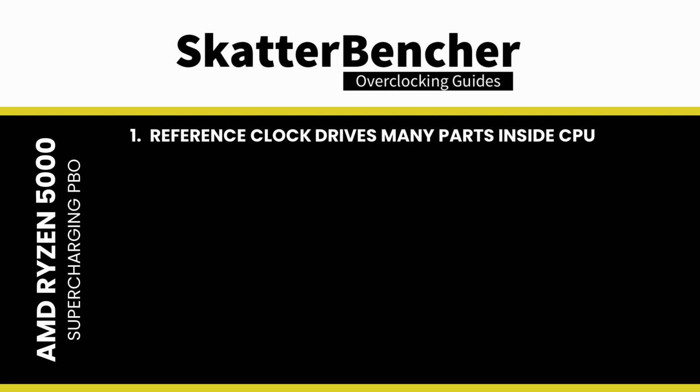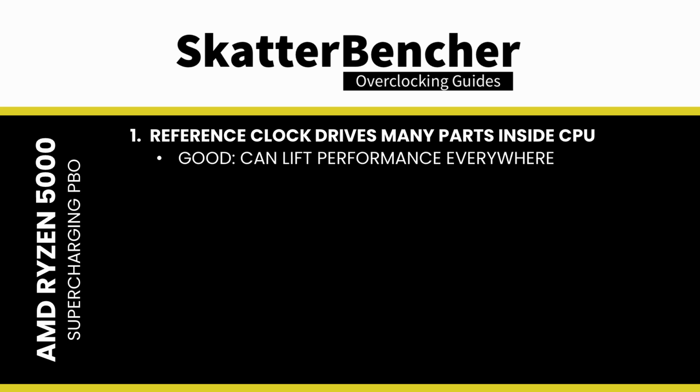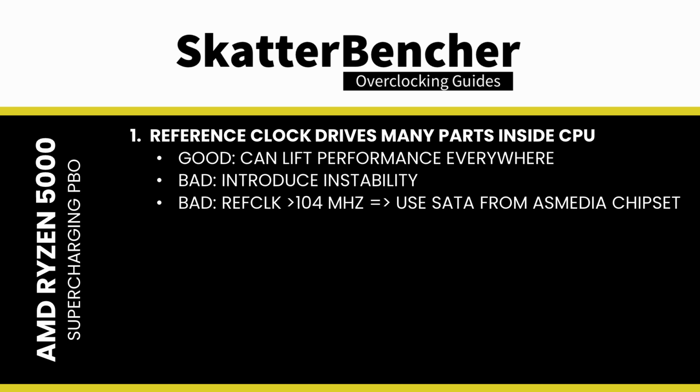While this may sound simple and straightforward, there are a couple of caveats. First, the reference clock frequency drives many parts in your system, including the CPU cores, but also the system memory, PCIe, and SATA. When increasing the reference clock, you change all associated frequencies as well. While this can result in additional performance, it can also cause instability. Fortunately, for most parts affected by the reference clock, we can adjust the final frequency using multiplier ratios. Unfortunately, not for all. The main challenge with using reference clock adjustments on Ryzen is bus interfaces like PCIe, SATA, and NVMe drives. On this particular board, when the reference clock frequency exceeds 104 MHz, the NVMe drives are no longer detected. So we have to use a SATA drive connected to the B550 chipset.